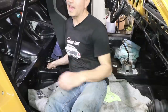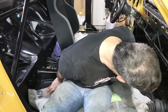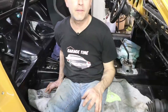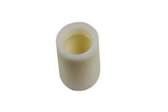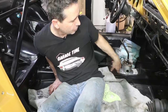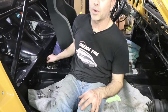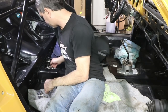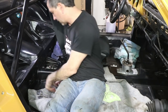So I can move that a lot, which means it was nowhere near in the right place. Just checking: this is vertical, all the way to the left. Before I go any further, I will say that I replaced all the bushings — there's a cup bushing down here and a guide tube bushing that holds the shift rod in place. All the bushings are basically new, including these bronze ones. So you should definitely replace the bushings before you adjust anything. Vertical here, all the way to the left here, and then you just tighten it up. I think I'm missing a lock washer — I should put a lock washer on here. It says 17 foot-pounds is quite a bit, so we'll make sure this is pretty tight.